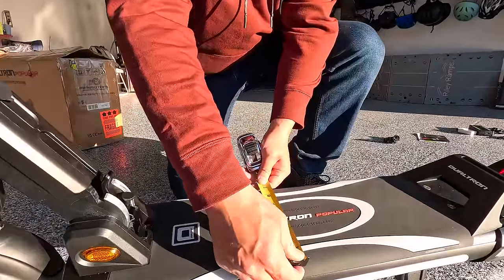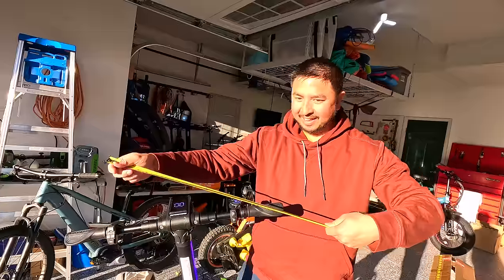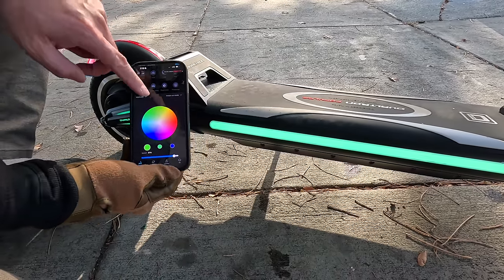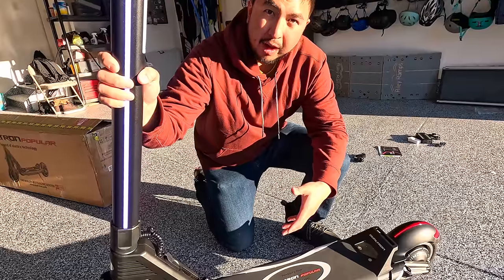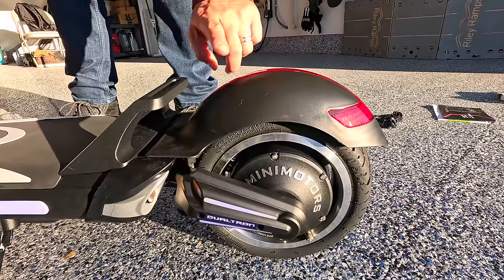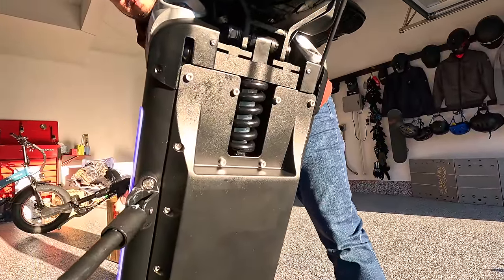The center of the deck is about seven inches and the deck length is 21 inches. The steering pole height from the deck comes in at about 39 and a half inches, and the handlebar width is 26 inches. Built into the deck are controllable lights — you can change the color and different patterns, and it also changes the control arms. Inside the deck there's a 52 volt 25 amp hour battery. This is the largest version; it also comes in a 20 amp hour and 14 amp hour version, or as a single motor scooter. There's a rear fender with a built-in light, a 450 watt rear motor with a nine inch pneumatic tire, drum brakes, and a rear coil suspension.